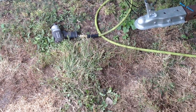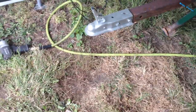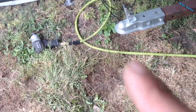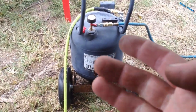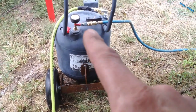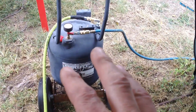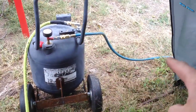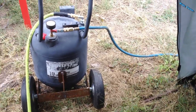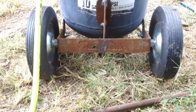One more piece of advice: I want to use the half-inch air impact gun and it's quite a long hose run back to my air compressor in the shop. I didn't bring my little portable compressor out because it really doesn't keep up with my impact very well. So what I did is I got a 25-foot hose going into an expansion tank right here — that means I've only got a 25-foot run from this tank to my gun, and then a long hose goes from this tank into my big compressor in the shop. When I let off the trigger you can actually hear this tank refilling because that long hose restricts the airflow, so having this expansion tank really close to my gun is huge.